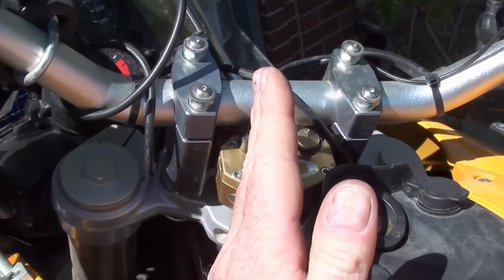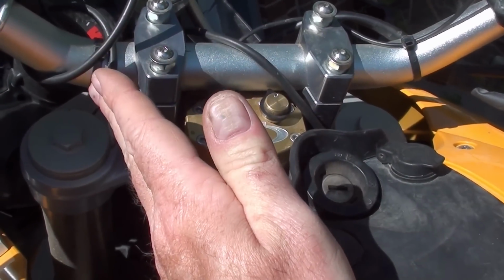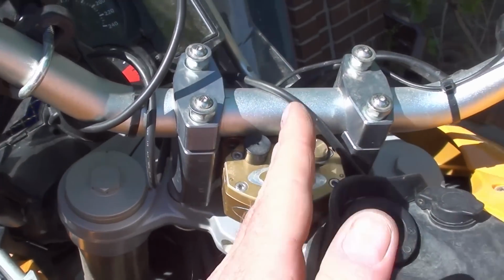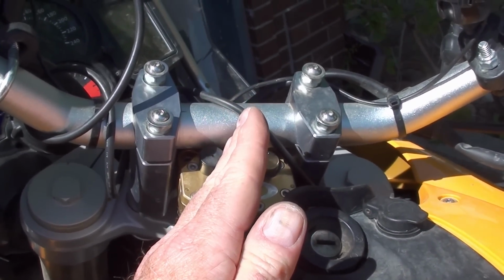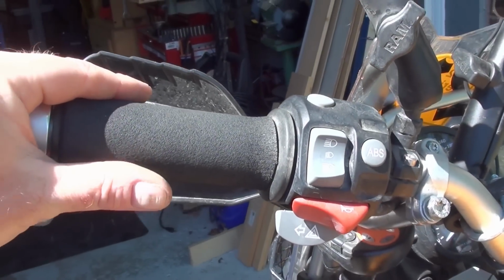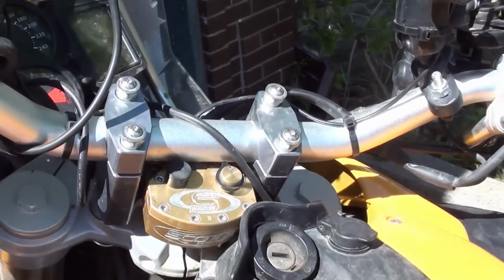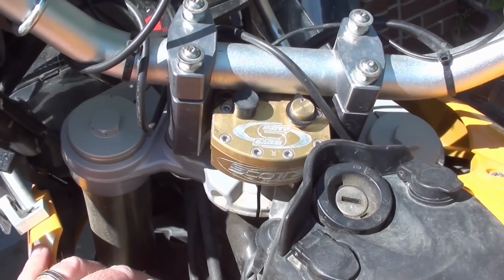You're driving along with that front tire, and when you hit a rock, instead of being deflected and then you have to do a big correction and all of a sudden you're flying all over the place, this really keeps that front tire going straighter, and it absorbs a lot of those big jolts to the handlebars, so these big jolts when you hit things aren't being transferred to the rider. So I find it much less fatiguing to ride with this as well.